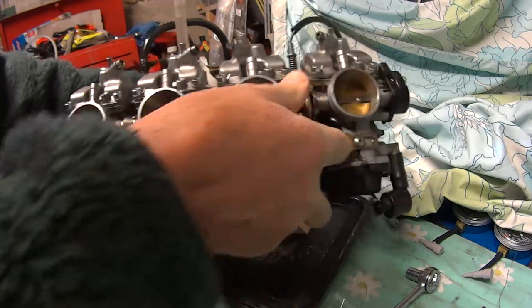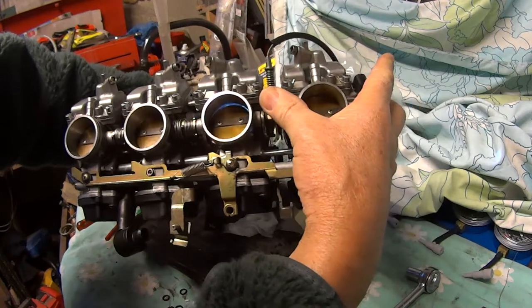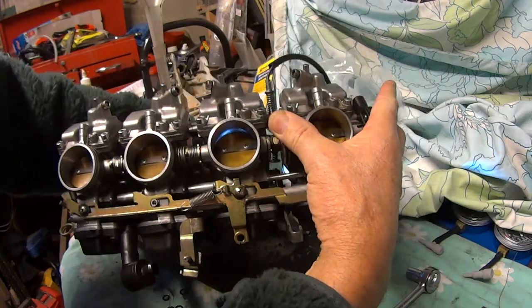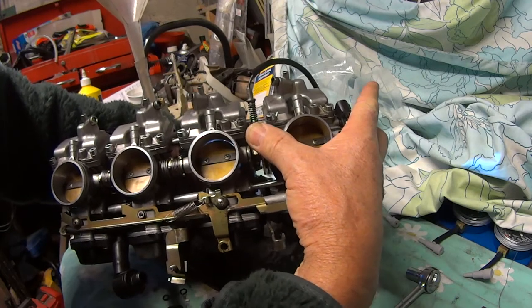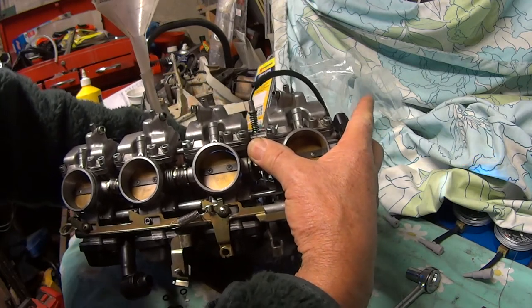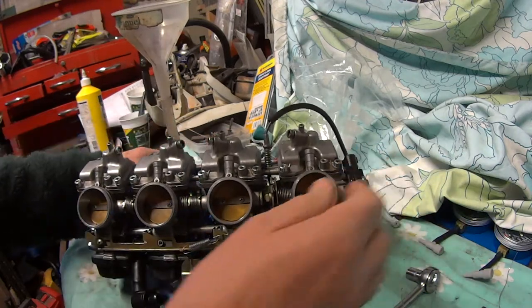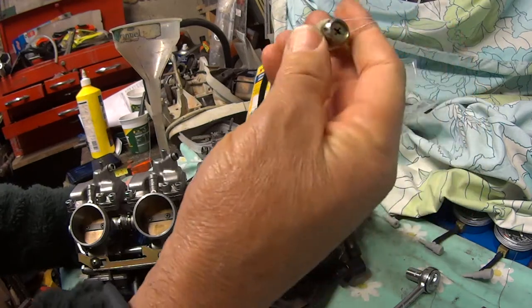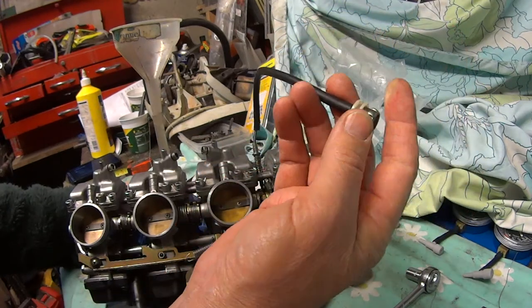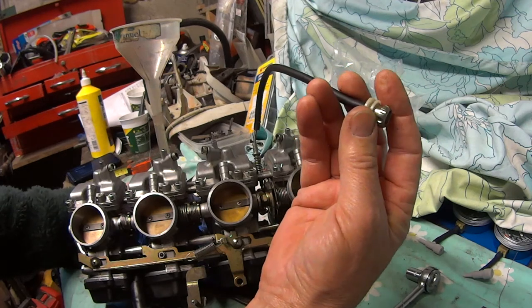You can see the light. My hand's in the way now, but you can see the light coming through there. And you can see, hopefully, when they're shut and when they're not. Leave them a little bit open, just a fraction, so you can just see a little bit of light, and then obviously you can adjust them when they're on with the throttle stop, because you might find that the revs are too low for it to run.